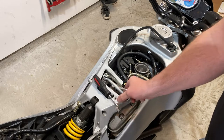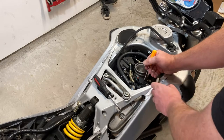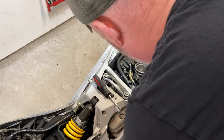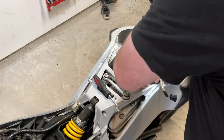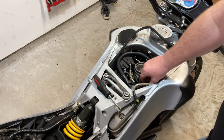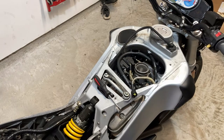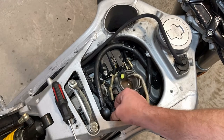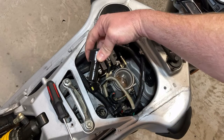All right, I got my mechanical fingernail here, and I'm gonna try and remove the fuel line without breaking this brittle plastic. Actually, oh, it's the opposite. I'm trying to pull it, dang it, I'm glad I caught that. So this one, there's a little red tab, and all you do is push in on it, and of course, this is in the way now. So let's take this out, and see, that's all that is.